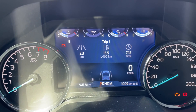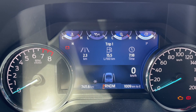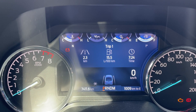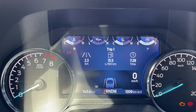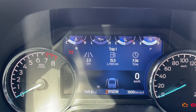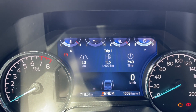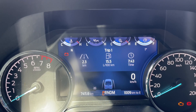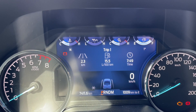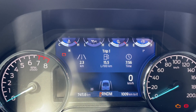I've just been to the gas station and filled it right up to the stop — I didn't top it off. It's about 2.3 kilometers from the gas station to here, with an average fuel economy of 15.5 liters per 100 kilometers. I'll convert to miles and miles per gallon later in the video. I'll use that to calculate how much gas it took to get to and from the station, and the balance when I fill up later will be what the truck used while idling running the generator.